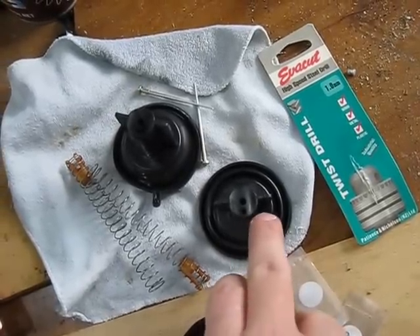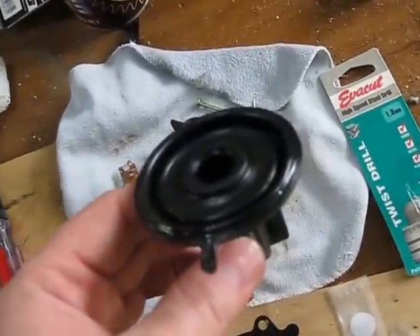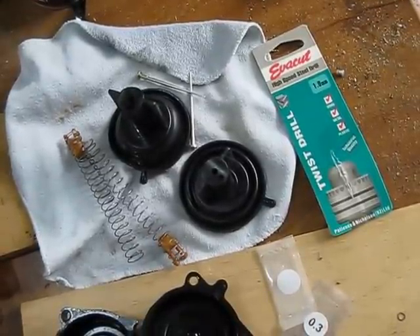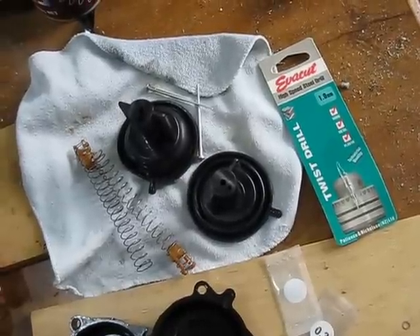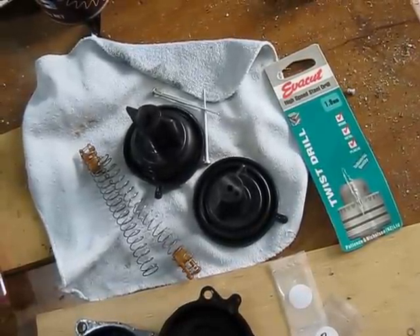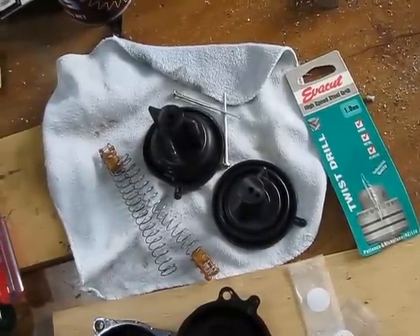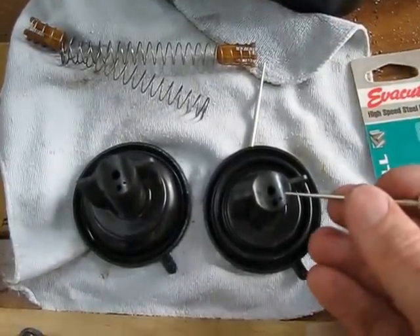Drilling that hole through the slide means the slide can now come up more quickly, which means it applies the horsepower more quickly. So you'd say the bike would feel more torquey — it'll definitely have more acceleration. It won't actually change on a dyno, but it'll feel a lot more powerful, which is awesome.